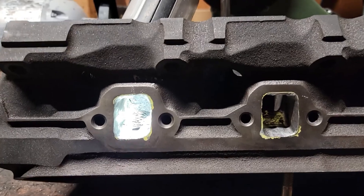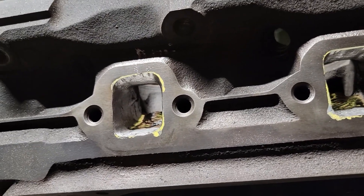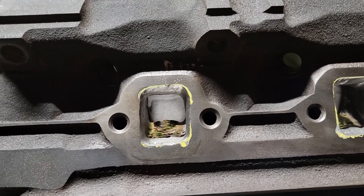I'm basically done with the exhaust port and the intake port. The only thing I still have to do is bowl a little bit down around the valve guides. EGR is gone and gasket matched for the most part — it's not perfect, but it's more flow than what it had. I'm just not a professional porter — I've only ever ported one set of heads before in my life and they're on a running vehicle right now, so I must have done something right. This is my second set of heads I've ever ported, and I'm doing my best.